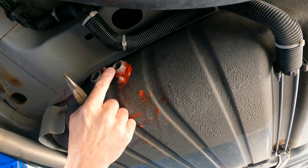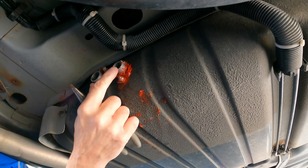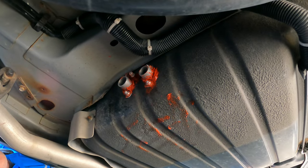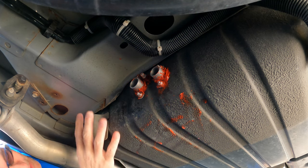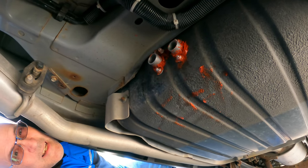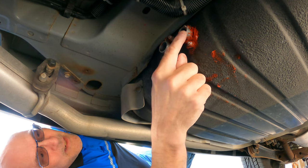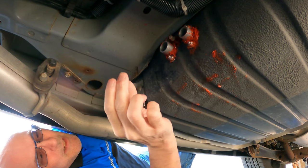Now, the exhaust has to come this way. The air intake is going to go that way. So there, as you can see, there's going to be a crossover. What I am saying that for is because, there we are, the exhaust pipe for the car engine is right here. So it only makes sense because there's so much protection over here built in from the car manufacturer to protect for heat that I will bring the exhaust probably down, or at least in this angle a bit, and bring it around,